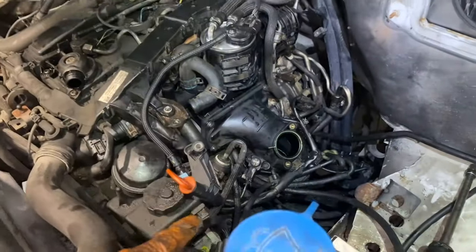I have my intake manifold, the neck, and the throttle body bolted on, and I'm starting to clean up bits and pieces around here. Fuel filter housing back in, water hoses connected up, fuel filter sitting in place, wiring loom back in place. Not a whole lot of ground made visually but it is an extremely awkward little job. I'm trying to do it as comprehensively as possible - making sure every little clip and bracket is back on correctly. Putting my intake system together before going on to test the EGR coolers.